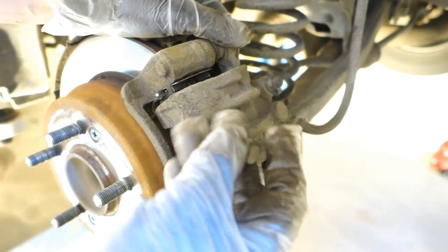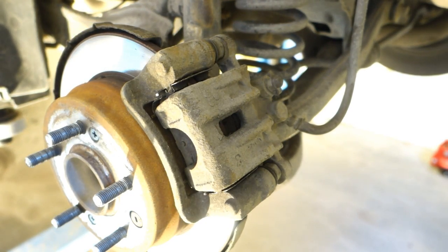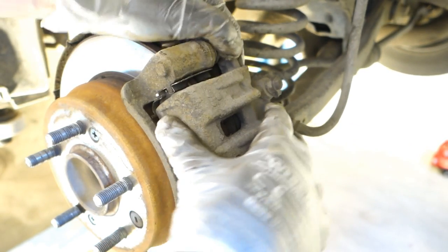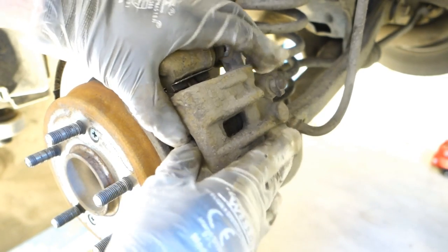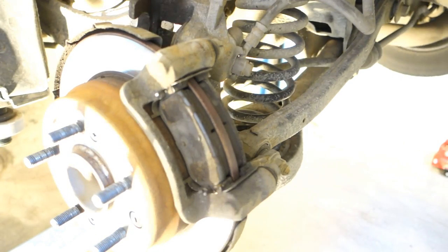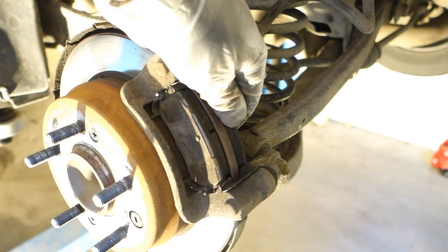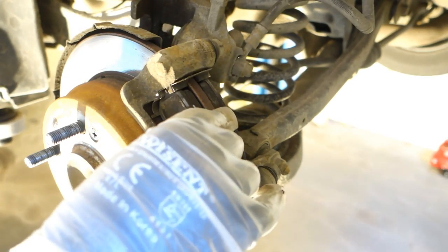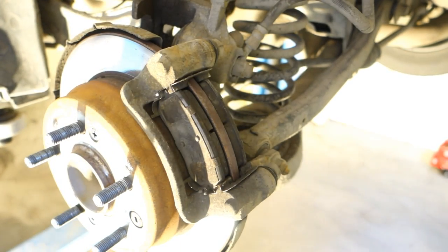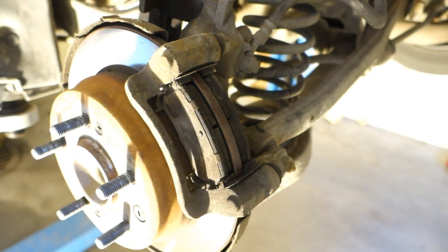And now there is a second similar bolt, and then normally when we move this brake caliper a little bit in that way, and we can use tongs, it normally moves away to this position, and then we can take these brake pads away. Sometimes this can be quite tight, like in here, and I need a little bit of extra tools. Okay, and now I have extra tools.